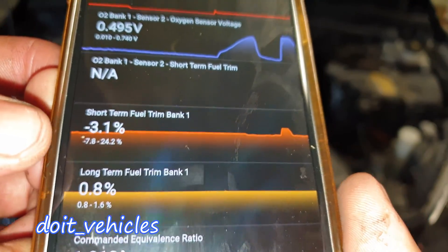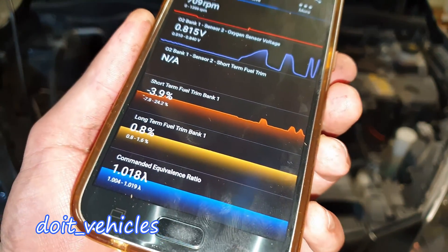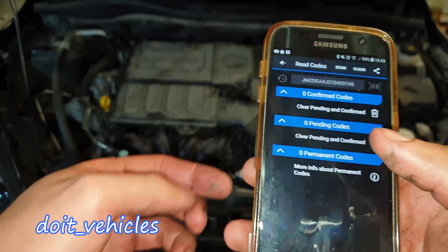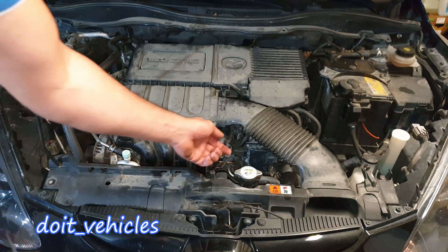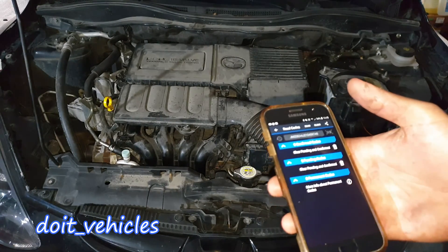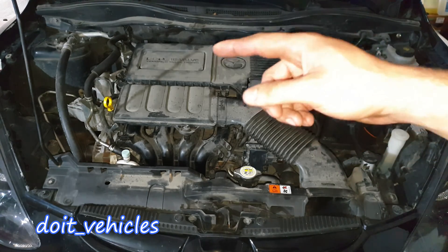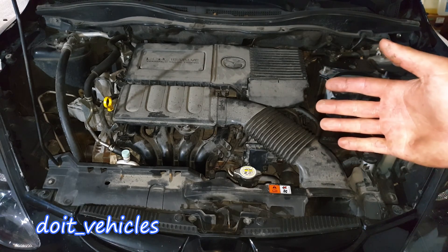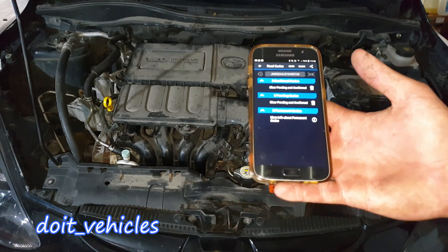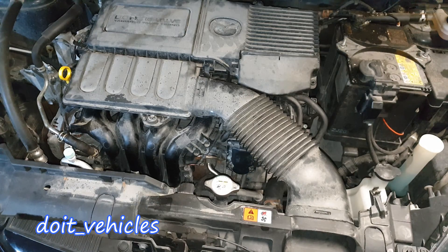The positive value hit 24.2. It looks like on this engine if there is more than 25% deviation from 0% it will stop the engine. There is no check engine light, which means the computer is still trying to figure out what happened and will try to adjust the injectors. From this we learn that the computer uses the injectors as the main tool to keep the air-fuel ratio at 14.7 to 1, and therefore the injectors are going to be under a lot of stress and can fail.